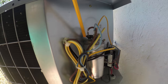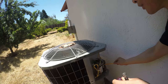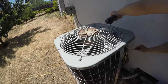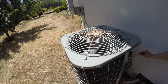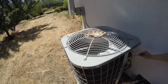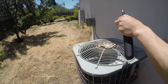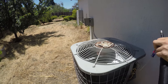The capacitor is bulged on the top — it's very likely it has a problem. Let's try to start the fan; you can move this. It's humming, and if you move it, it will try to start. But you still don't have cold air because the compressor may not start — the fan can start, but without the compressor you won't have cool air.